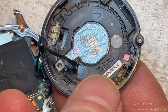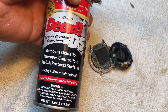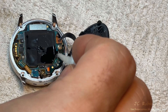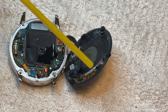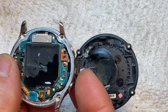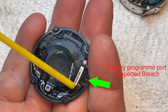I spent a few minutes with compressed air to try and dry out the unit from any remaining water before proceeding. Now we're going to see how well DeoxIT comes through. I can't just disconnect the connectors — they could crack apart from the rust — so I'm using capillary action with the DeoxIT to wet them and this area too. After letting it sit, I used a screwdriver to pop it right off with no damage done. That part is sprayed with DeoxIT and set aside to soak.